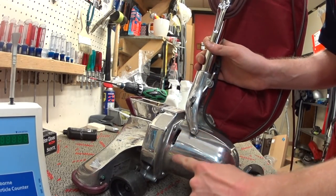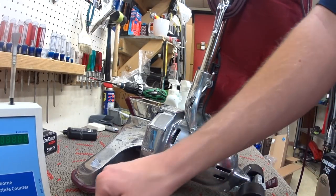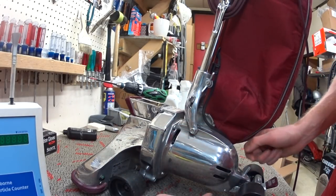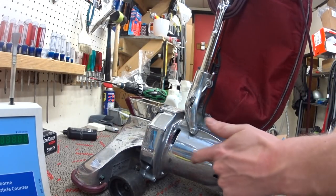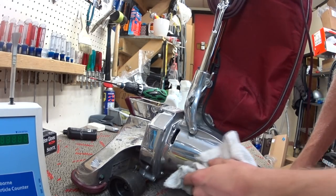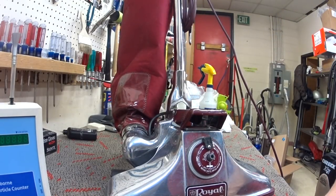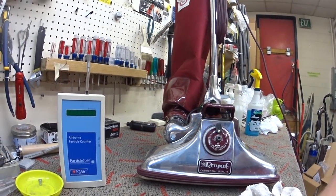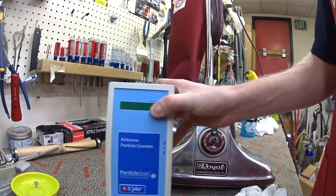And then through here, it's a very dusty, carbon dusty machine. It's actually sucking up dirt because it creates so much vibration down at the nozzle that it loosens stuff around it. And it's sucking dirt that's loosened up around it and then blowing it out through the room through here. So you got more than carbon dust going through here. So that's why that doesn't filter particularly well. So would I recommend that for allergy sufferers? Of course not. Especially considering the bags don't self-seal. Though if you're on a budget, it's not a bad vacuum. But that's how it works with a particle counter.